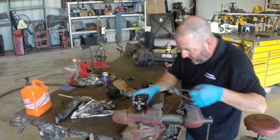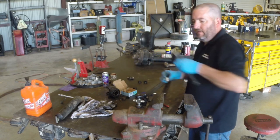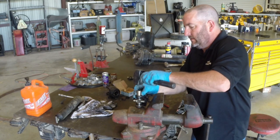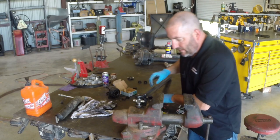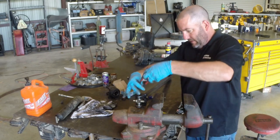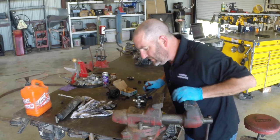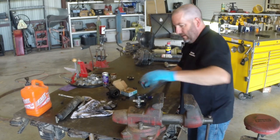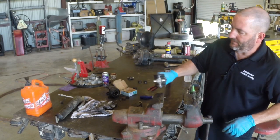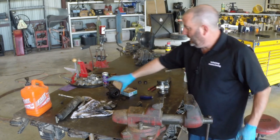If this cup doesn't go in on its own, we can set it on the back of the vise and tap down with a socket to make sure that clip goes in its groove nice and easy. I'll give it some love with the pliers just to check and make sure I'm happy with that. The joint moves — all right, let's get complicated here now.